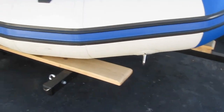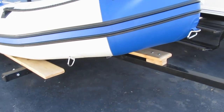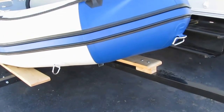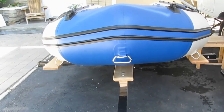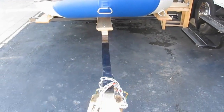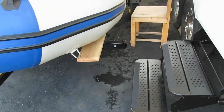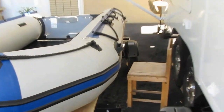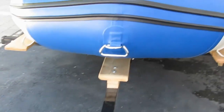This is the final way the wood was cut so that it doesn't interfere too much with turning and walking around the boat. The boat sits pretty much on those wood pieces, and the keel is inflatable so it's deflated at this time — with it deflated the whole boat sits very nicely on the trailer. I've added a galvanized tongue piece, put the chains on, connected the wiring, and added wheel guards so that we don't mess up the boat. All in all, it's a pretty lightweight trailer since it was built using 2x2 1/8 steel tubing.